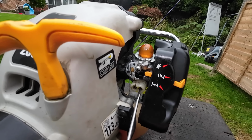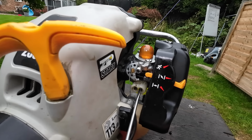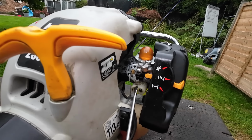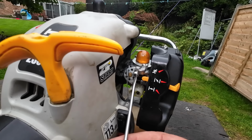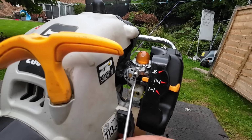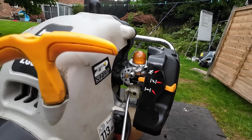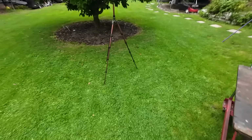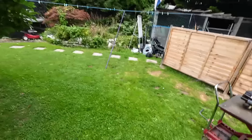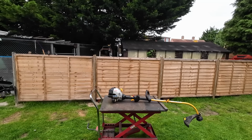it depends. And then once you've found the sweet spot on the high side, you can then go over to the low side and tune this one, but then you must bring this screw back out. Once this screw has been taken out slightly, you're then tuning it on this one here, okay? You want it to tick over on this screw, not this one quite so much, okay? So, we're getting there. You can hear by the engine revs, it is picking up. So we are sort of winning.